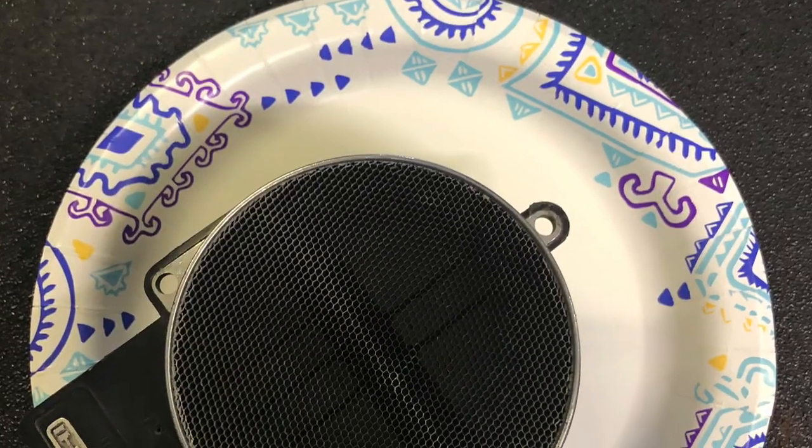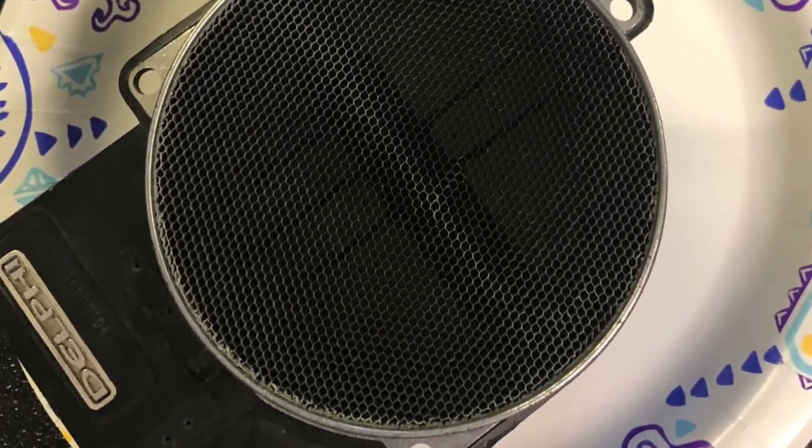Well, guys, the tune doesn't change. It doesn't alter itself. When it's on, it's on. So you start having problems with drivability, start having issues with startups, whatever. What changed with the car? What happened? Did your plugs go bad? Did you foul one? Do you have a burnt spark plug wire? Is your MAF sensor dirty? I mean, those are things you got to maintain, especially higher mileage cars. If you don't keep up on maintenance, you're going to have problems.